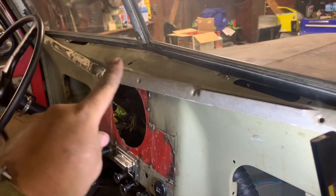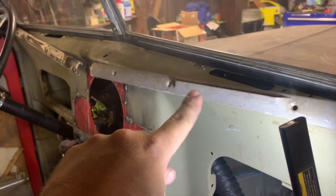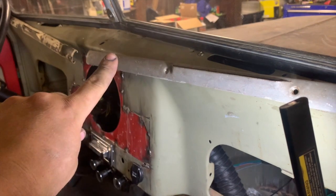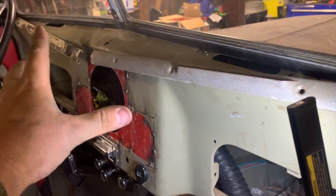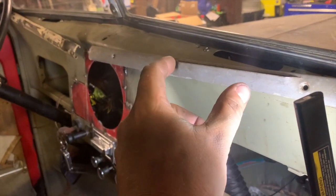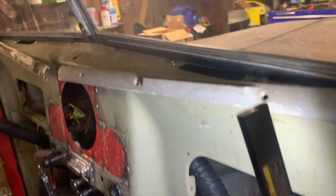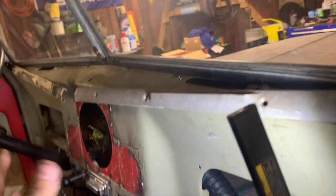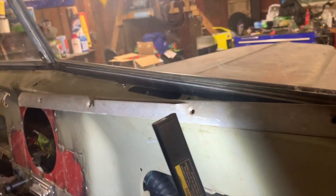little short piece, the 16-inch piece. So I put the 16-inch piece and the 5-inch piece together with the motor and the gearbox, and I put that all in together, slid it through the glove box here and up and over, and I got it put in place after I took the vents out, tightened up the bezels, and got that set.